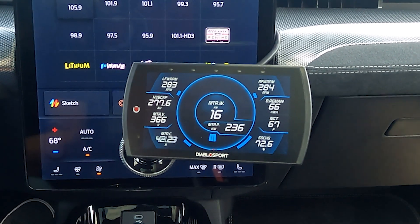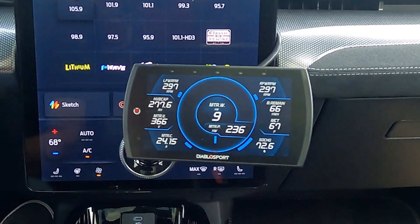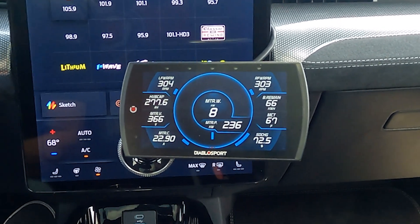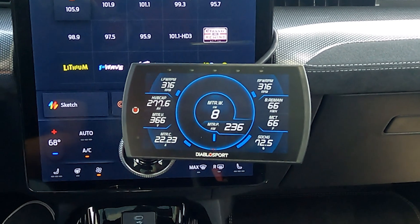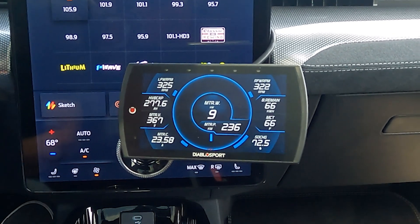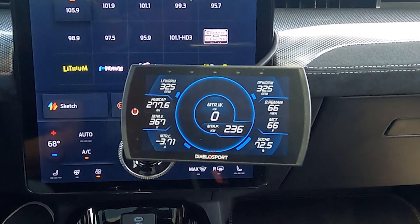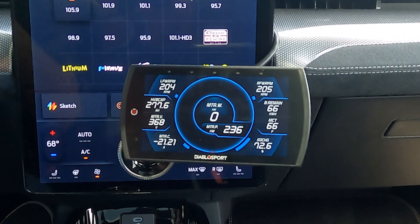You can also see what sort of torque output can be maintained to keep the battery alive longer. If you need 80 or 90 foot-pounds of torque to maintain highway speed you'll see the battery draining quite a bit faster than if you were only looking for 60 or 70 foot-pounds of torque — these are the kind of things that really help you correlate what's going on in the vehicle and why it's happening.